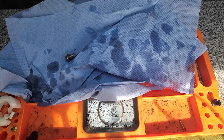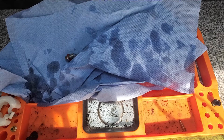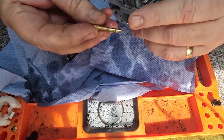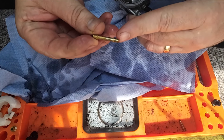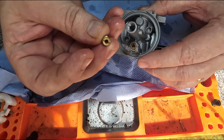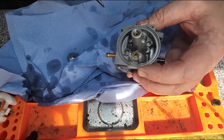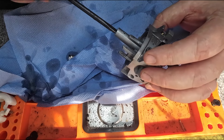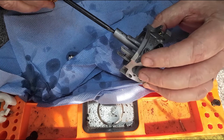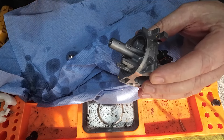Carburettor can now be put back together. The most important thing is to wipe your hands free of any debris — you don't want to introduce any more dirt. The emulsion tube is the first one to go in, with the little tiny spout going in first. Then get your main jet with your flat-headed screw facing upwards — plop him in. Then get your screwdriver and just gently, gently nurse that little tiny flat-headed screw down. Once it's seated, just a little tiny nick — it does not want a lot.